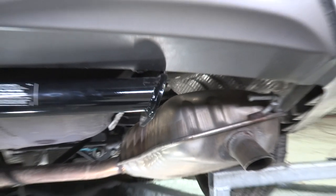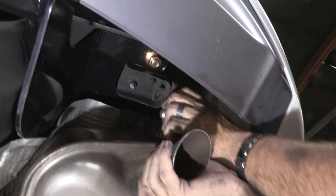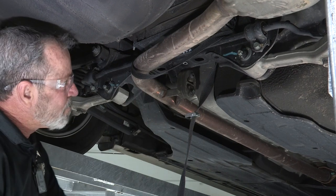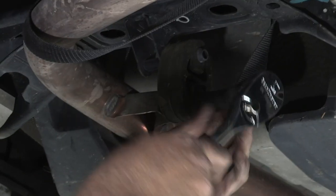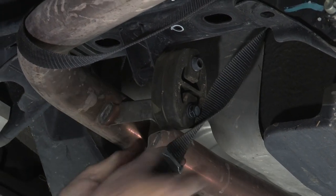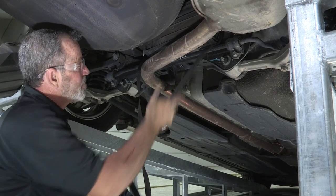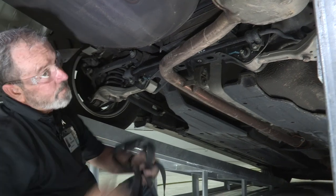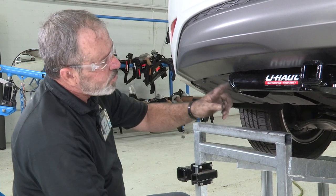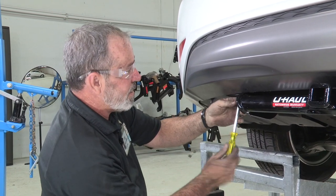Now we can go ahead and raise the exhaust back into position. We're ready to raise the exhaust, starting at the rearmost exhaust hanger isolator bracket, then we'll go to the most forward isolator. Now we can go ahead and remove our support strap. Our last step is to get the underbody paneling on the driver's side back up. The instructions do call for trimming an edge, but I was able to get mine up without any trimming needed, so we'll just finish up these last few bolts.